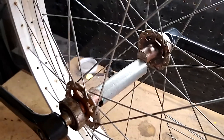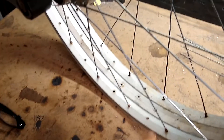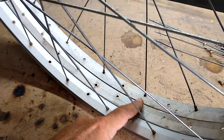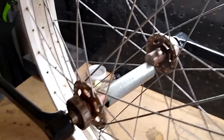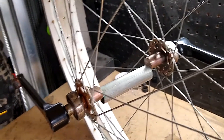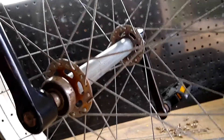This is why it's a good idea to run a test. I was expecting that the additional space required on the inside of the hub would be essentially one rim width, and I could understand how it could even be the distance from hole to hole - but it turns out it's actually quite a bit wider than that. Looks like I'm going to have to cut another piece of pipe so it can be long enough. I've got my wheel laced together - the hub isn't welded yet - but I just wanted to make sure all the parts fit. The spokes are not tuned but reasonably tight, and I think this is all going to work out fine.